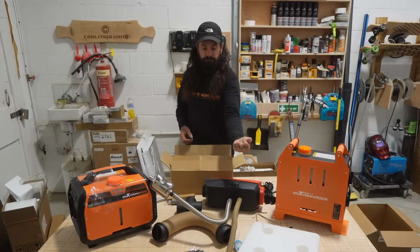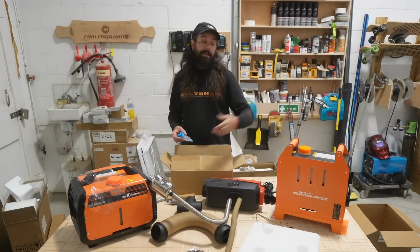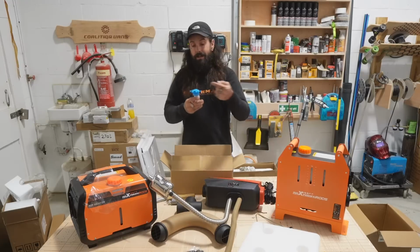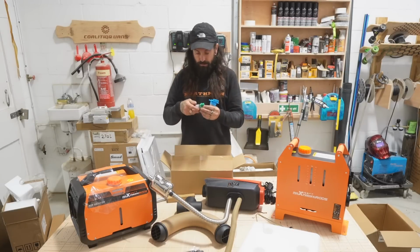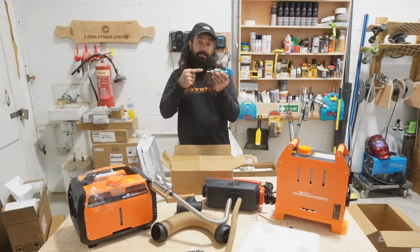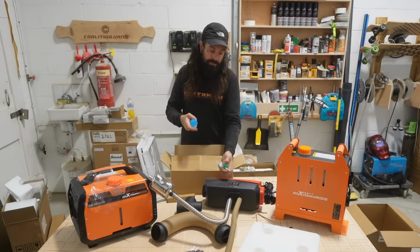You also have a fuel filter, which you can put in line as well, so it filters out any particles, especially if you're going from your main diesel tank. You're going to want to use this so it doesn't pick up any rust or any bits of crap that's settled in the bottom of your diesel tank. So it will come from there, through there. It's even got an arrow on it, tells you which direction it goes, which is Bobby Dazzler. And also this should have an arrow on it as well. This doesn't, oh yeah it does, 12 volt, and then it has an arrow, so you know that this end here is from your diesel tank. For example, there, it'll filter through and it'll pump diesel that way up into your diesel heater.